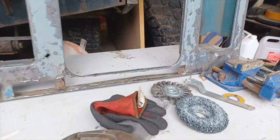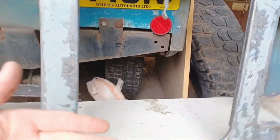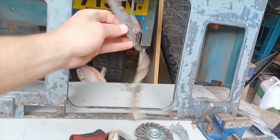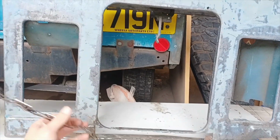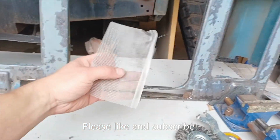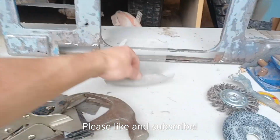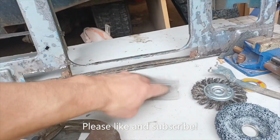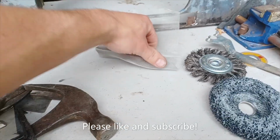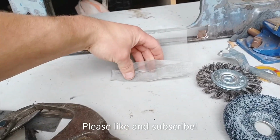Okay, so we've got the part, still quite hot actually. So we've cut this part off. And then we'll make up the missing part with the aluminium mesh here. Very good stuff, very malleable, fairly rigid, rigid enough anyway to hold whilst the fiberglass filler goes hard.